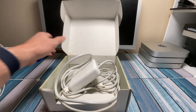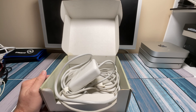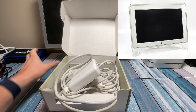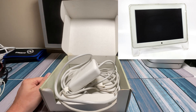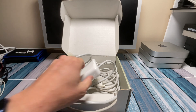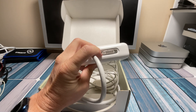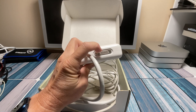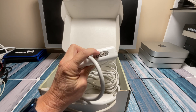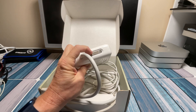We talked about this Cinema display last week, but the ones that came out before this — the ones that had the plastic look to them, kind of the clear polycarbonate sides — they all used ADC connectors. Now an ADC connector is this right here; this is the female part of it. So on the monitor itself, it would have the plug that goes into this. What's special about ADC — it's very similar to DVI — but it also carries power and USB on it. So it's all in one connector, which is kind of neat.